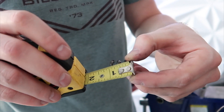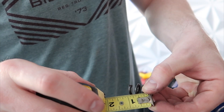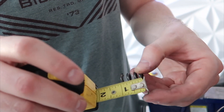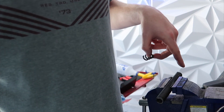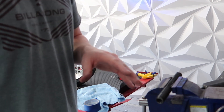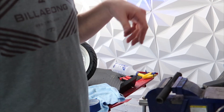I marked it right here - going to give it a little cut and get this going. From where I marked it, you can see it is exactly one inch off. I'm going to let it cool down from where I cut it, put it back in the fork, and then do the other side. The reason I'm not doing both sides at once is because there will be no pressure in the forks and the front end will just straight drop down - so I'm not going to do that.